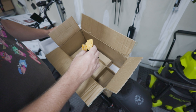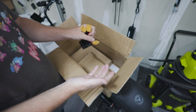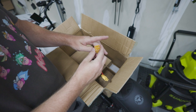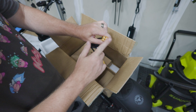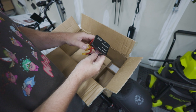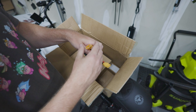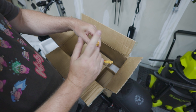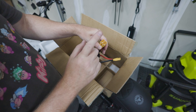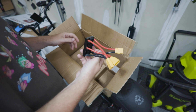So this is the battery balancer. It is how you add a second battery. It basically splits the battery to a parallel connection and creates two connections for your battery, and this plugs into the controller. Usually there are labels on these, but this one doesn't have it. You cannot mess this up if you're only putting two batteries on your bike. The XT60s with the male end are for your batteries, and this one goes to your controller with the female end. Pretty simple.